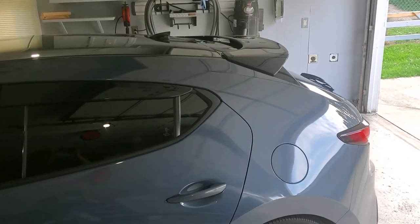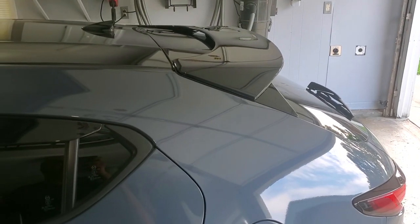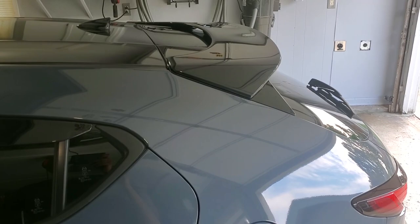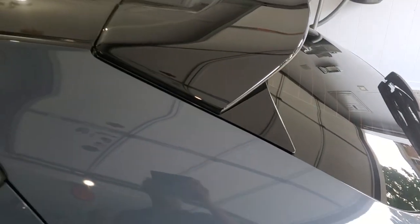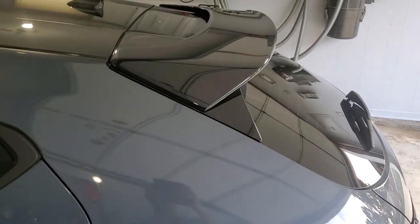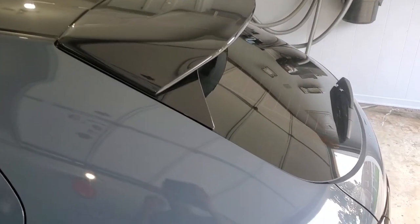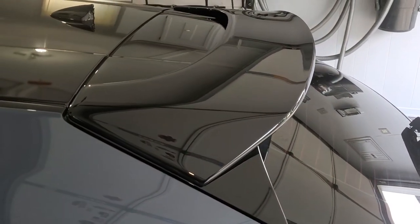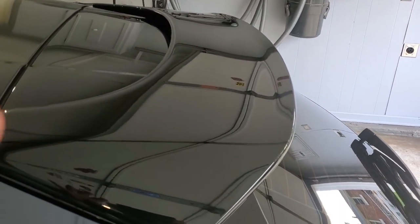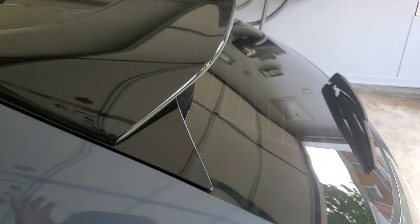The wing is done. This is probably a do-it-yourself job — Dremeling those holes off. There's lots of clearance, and you don't have to worry about poking through, and even if you did it'd be hidden underneath. I drilled out those holes like it said — 10 millimeter holes. I elongated it just a tad. I didn't use the paper templates that came with this; I literally had everything upside down, test fitted it before I undid the double-sided tape, and it looked great.